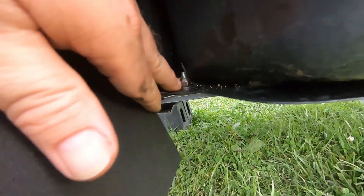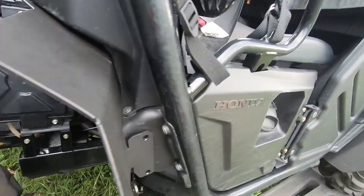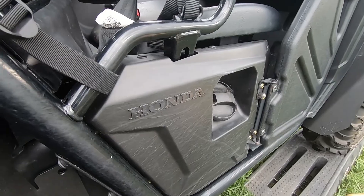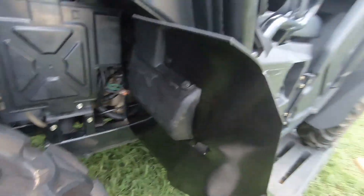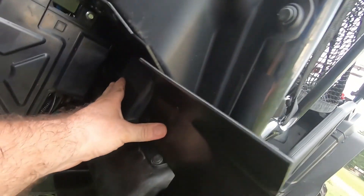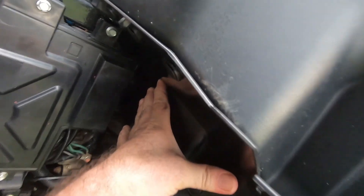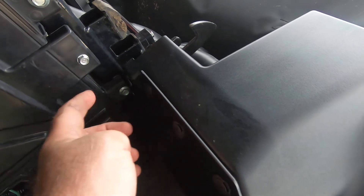This piece here, we folded up under the bottom. Then you put the bolt through that hole, add a washer and a nut and tighten it down. We've already put this push pin back in there. I guess it's a matter of just lining this stuff up. This passenger side lower is a bear — you gotta make sure this fits back behind here and up here at the top make sure it fits in behind all that stuff good. I held it with my left hand, held it all in place to where it looked like it was falling, then started drilling and put a push pin in, drill, put a push pin in, and so on.